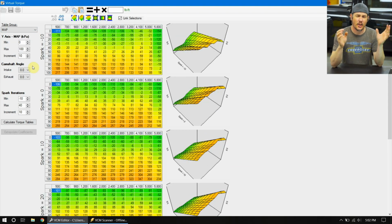Okay. Let's say that you go out and you get a supercharger or something and you throw it on your vehicle. We know beforehand that we were basically trying to achieve no vacuum at wide open throttle. Now we're actually going to have boost on there. So we can kind of get an idea of how much power we should be generating based off of that. So if we were making 500 foot-pounds of torque at no vacuum at wide open throttle, and say we add 7 PSI, we should be getting about 50% more power. So we can add that in there and say, well, now we should be up in the 700 foot-pound range. That's fast and loose.